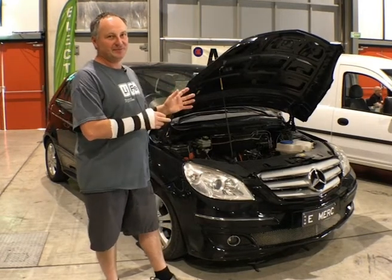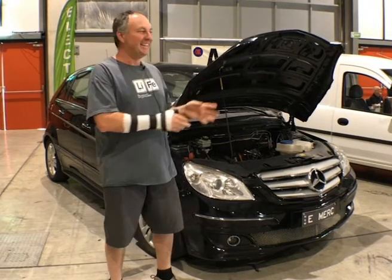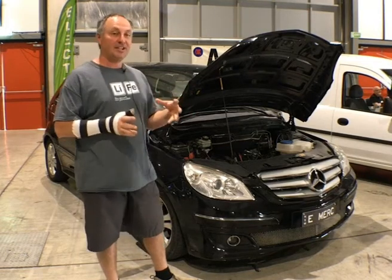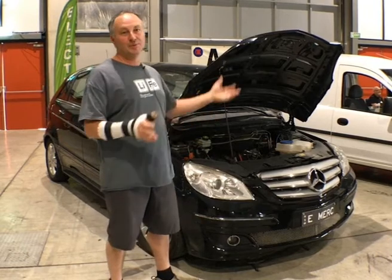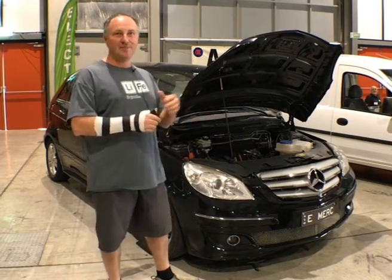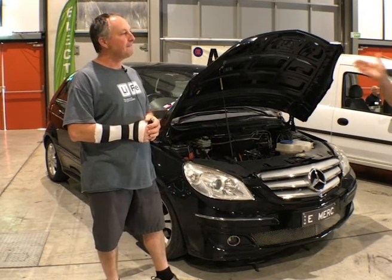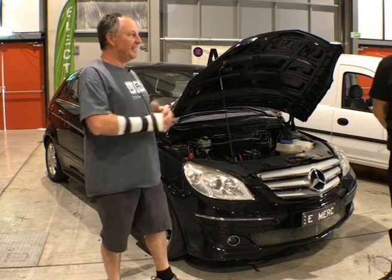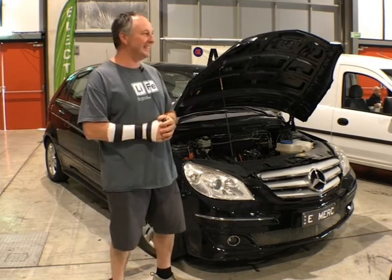As it's a Mercedes, it does have air conditioning. John drove it for a good number of months without air conditioning, so that wasn't the most pleasant car to drive. It has an electric air conditioning compressor which is mounted underneath the body — a condenser — it all works like a normal system except there are no belts. You basically just push the button on the dashboard and it gets cold. Jeff actually installed a new compressor at one stage; it's underneath the driver's seat, outside of the car.